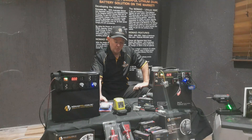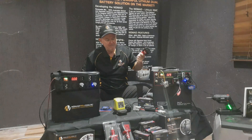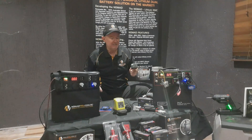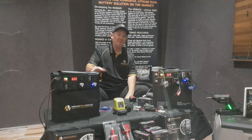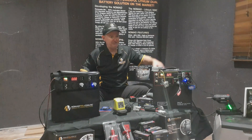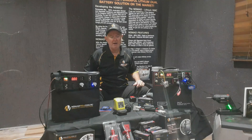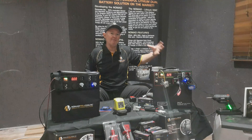The other product that's very important is your pocket inverter. These are 150 watt pocket inverters, around $40 from ourselves or our partners. They're great because they've got 240V output at 150 watts. Very important to understand — it doesn't mean you can plug anything into it. If you want to run your compressors, winches, microwaves, ninjas, all those high-powered things, get yourself a 2,000 or 3,000 watt inverter, connect up to your crank battery with the car running, and run it for the two or three minutes you need.